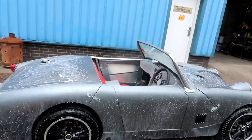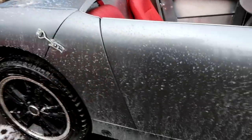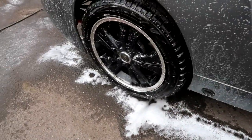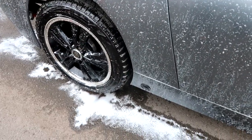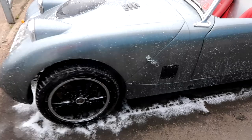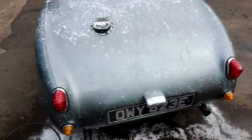I've managed to put a nice coating on it without getting too much inside. Now, when you put your snow foam on, I see a lot of people put it on really really thick — you have like a blanket on it. You don't want a blanket; you want to put it on thin enough that it drips, because the point of it is it's breaking it down, lifting all the contaminants, loosening them so they can either flow off as you leave it. We're going to leave this for about five to ten minutes to do its work. If you put a massive thick blanket on that doesn't even move, you're kind of defeating the point. So this to me is the perfect covering.